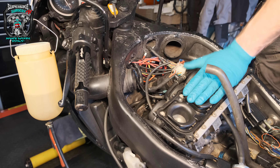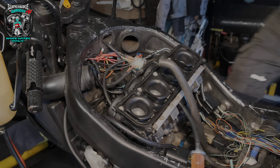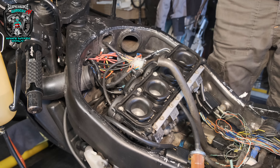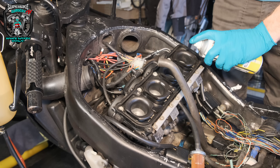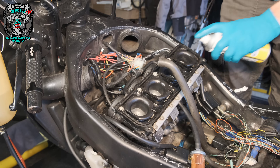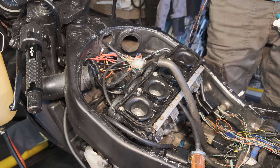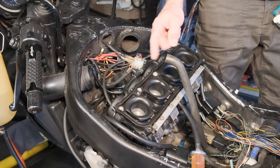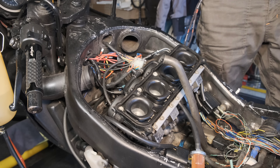Hope you found it interesting — a couple of top tips in there for you. Do you want to see me do something really nasty to a motorbike? Easy start — I hate this stuff. Anyway, you get the idea: there IS ignition now, which it didn't have before. The carbs have got to come off it. Did you notice how heavily it was breathing from there just from cranking — slightly concerning. My work here is done. Thanks again guys, see you soon.